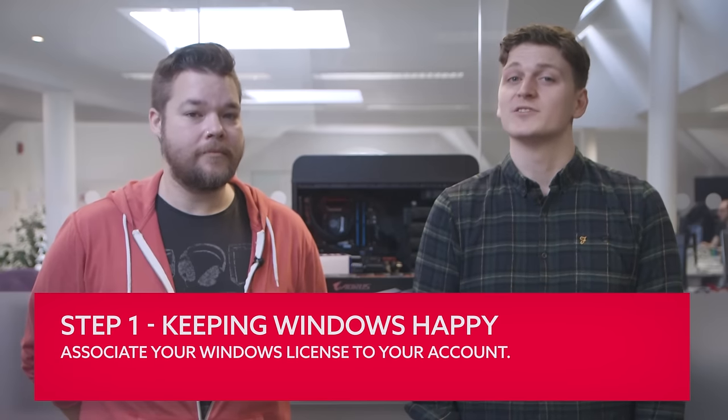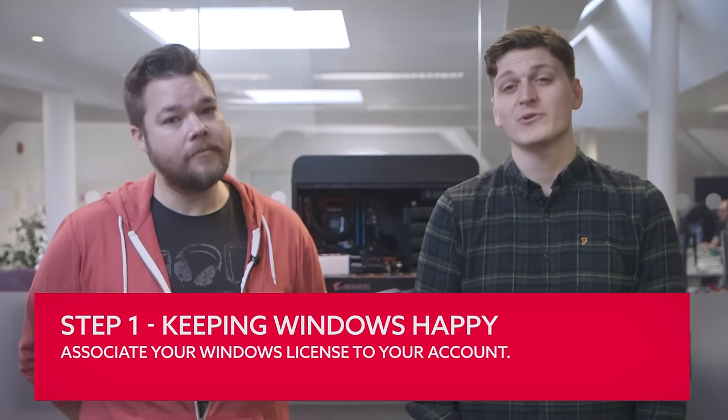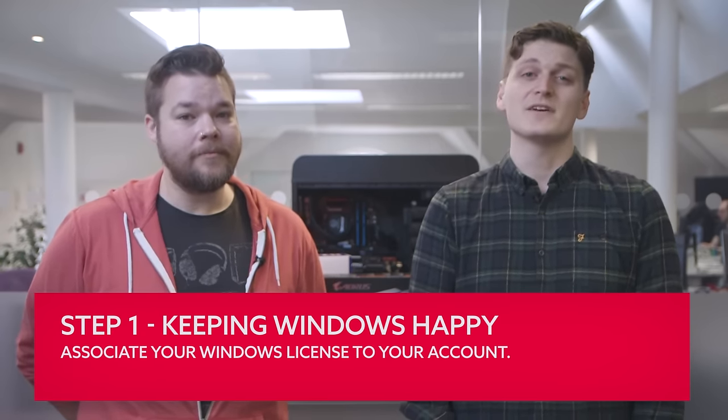If you're using Windows 10 it's worth making sure your OS installation doesn't go screwy when you replace your motherboard, as Windows can get funny when you do such serious PC upgrading. If you already sign in with your Microsoft account then your PC's license will already be associated to it. But if you sign in with a local account then you might want to do it manually to avoid any issue when you restart. This does change your login from local to a Microsoft account login, but you can revert it later.